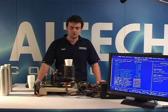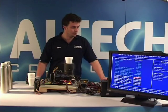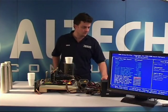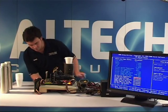So it's quite a slow process, but that's a good thing as well, because when you hit a cold bug, you have to warm up the CPU basically. So if it was going down fairly quickly, then you'd have quite a few problems relating to cold bugs. Okay, the BIOS is just frozen. As you can see, I'm trying to use the keyboard and the BIOS is not moving. So basically, we need to reset the machine at this point.